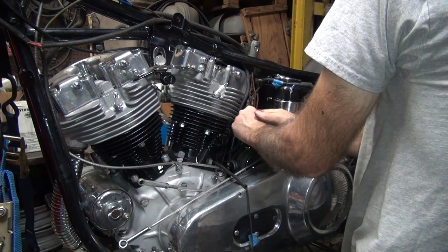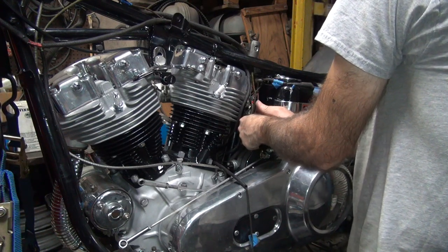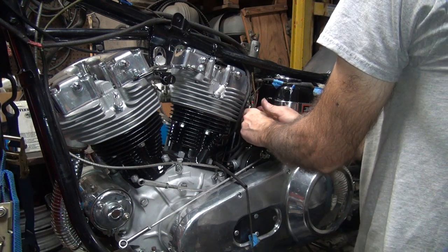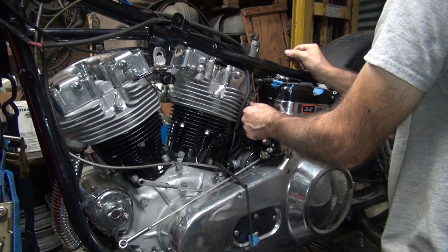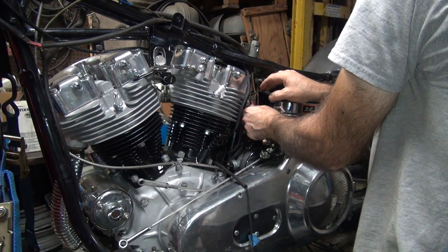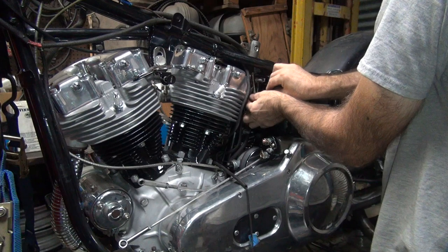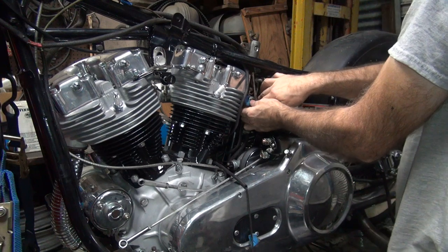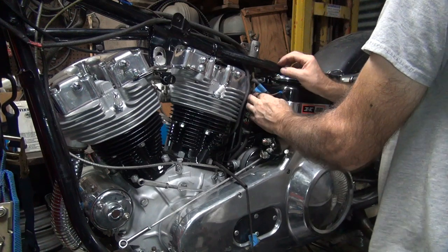One on the primary cover with your bike — you got a sample of it. There are two or three different variations of that O-ring that go in there, and I'm not sure which one you're using. You're in the overlap years between Evo and Twin Cam so it's kind of a toss-up which one you have. I don't know which one it is for sure. I can guess it's going to be the earlier one, which is just a round O-ring, but I can't tell you a hundred percent if that's what it is.